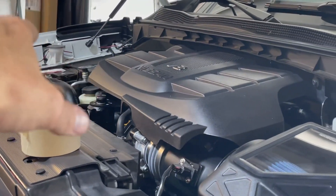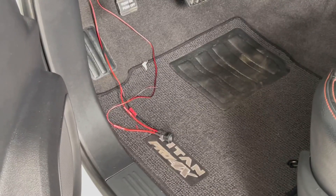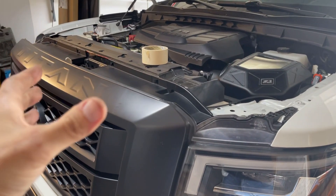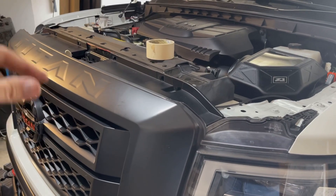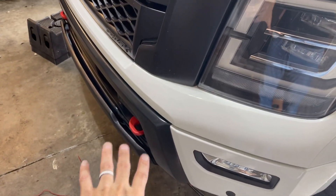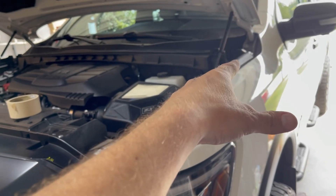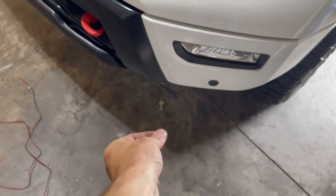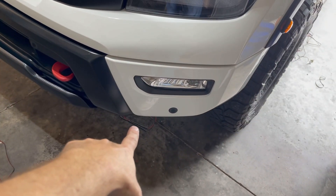You've got to get power to the switch, so I had to run wire from the battery side and tucked it away in the shroud. The problem with these lights is that you have to run them in parallel — you can't run them in sequence. You have to bring all the lights back to the same power source; you can't daisy-chain power out through each light. I think I'm going to run out of wire, so I'll only get the front ones done. Power runs from the battery into the grommet to the switch, then from the switch out to one light, and wire runs from that light over to meet the second one. Both lights meet the same power source and the switch runs them both. I'm going to hook the battery up just to make sure everything is good, then heat shrink these to make sure it's all sealed up and safe.